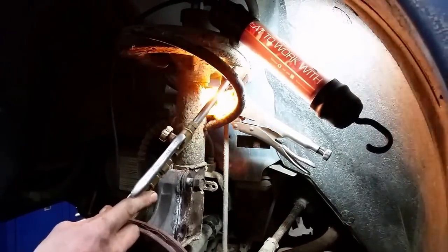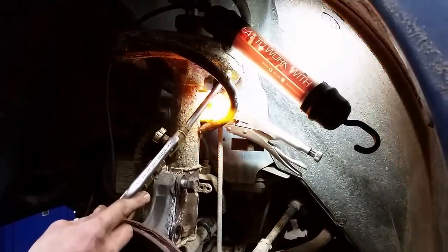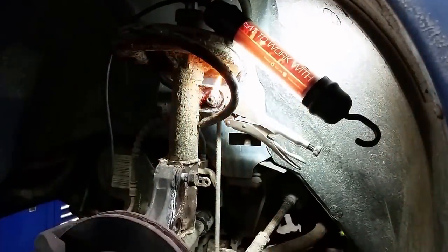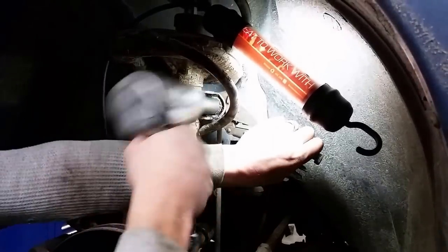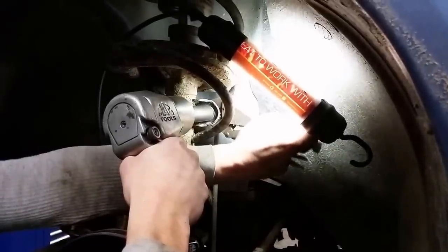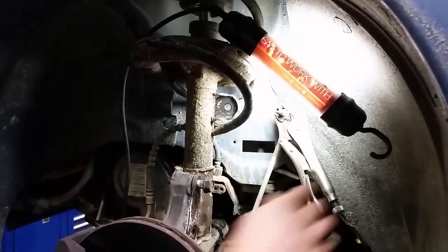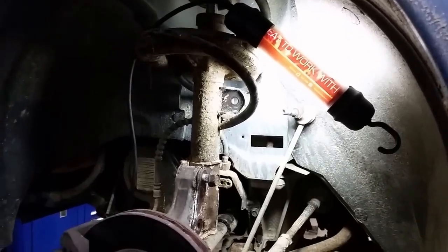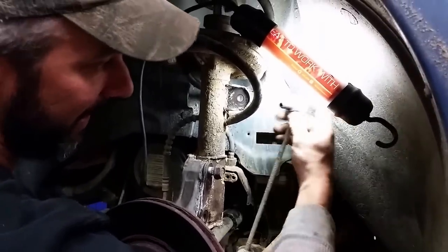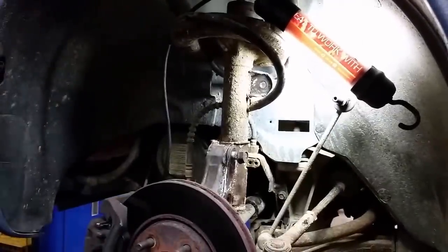I know everything reads don't heat a strut. Long story short, just don't be an idiot — don't stand there all day with it. Once you get the nut heated up, check the torch off. It's an 18 millimeter. Back that off. At that point, it's up to you whether or not you're going to reuse the sway bar link. It doesn't hardly get them hot at all. It doesn't damage the boots on them. They're totally reusable if you'd like.